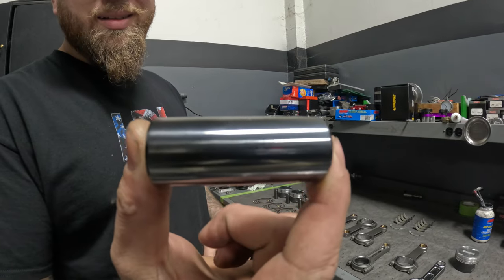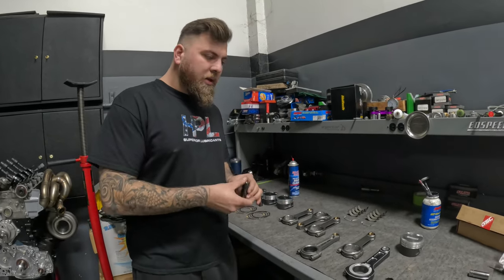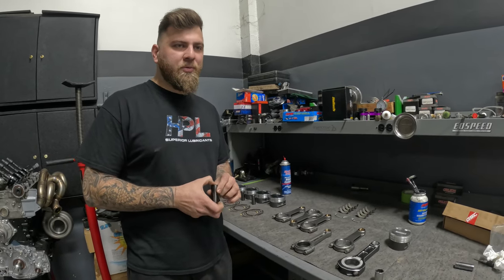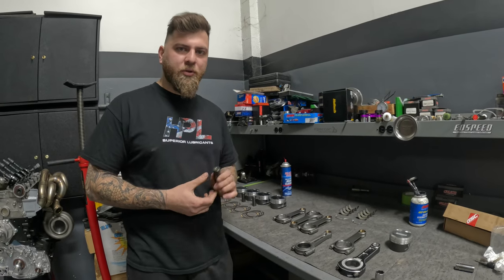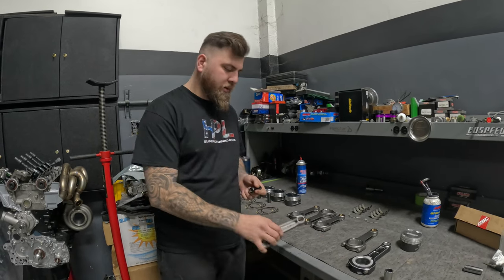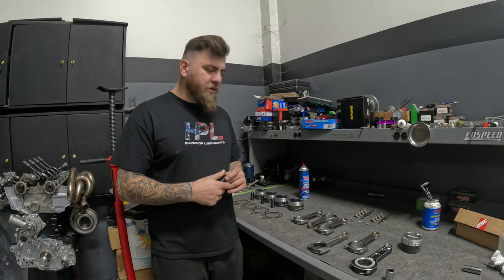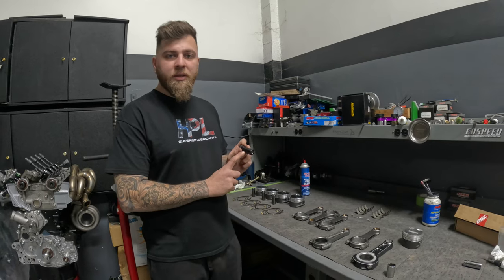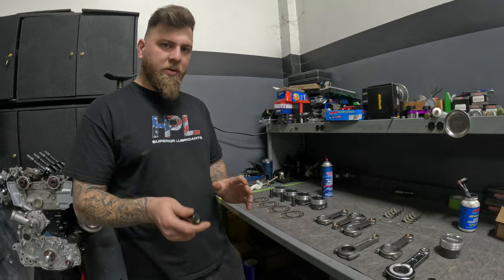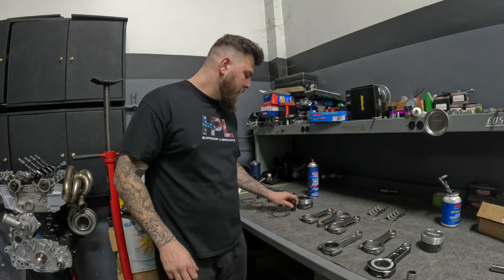I love these DLC coated pins — we always talk about these and they're included in all of our builds. These specific pins are the H13s on a Gen 2 piston; our new ones have the TP1 pins, which are a little bit thinner at 220 wall. I shouldn't call them thin because a TP1 pin at 220 wall is literally stronger than a solid slug. So what we're doing is reducing reciprocating weight and it's a little bit easier on the bearings. The more weight you can reduce while still retaining strength, the better — your bearings are going to last longer, your engine is going to wear less, and there's less stress on the components. The DLC coating — diamond-like carbon — helps if there's any oil dissipation and the engine runs dry for a couple of seconds; this is not going to fuse two parts together where otherwise it would.